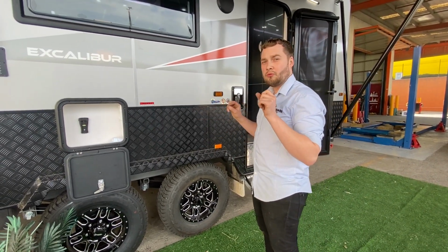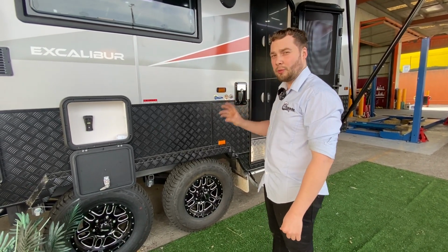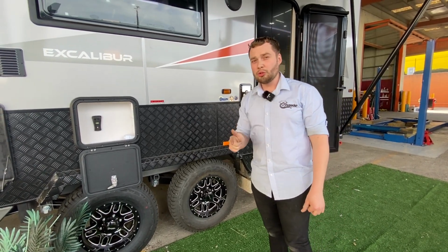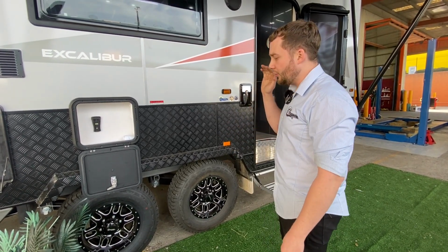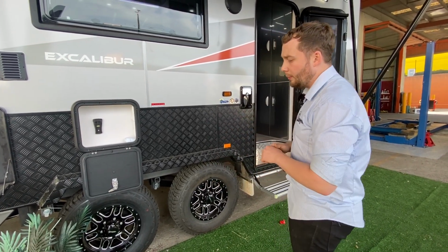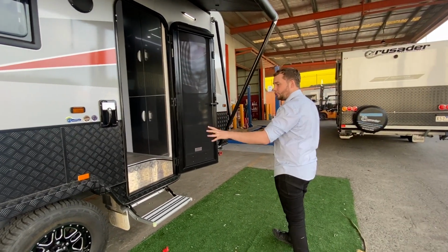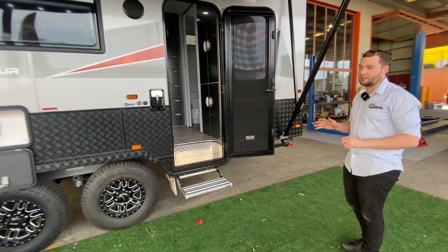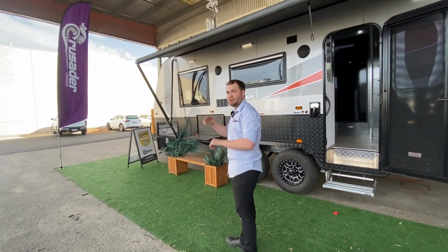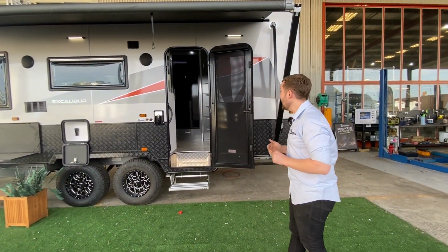Featuring a very, very high quality, Australian made, tough ride, 3.3 ton, 10-inch brake independent suspension. So that's a single shock coil spring suspension with the ability to adjust camber, and these are fully wheel aligned before you get them as well, just to make sure, again, trouble-free, but mounted onto a subframe like the Intel Engineering chassis with a 6-inch A-frame that runs all the way back to the wheels on top of that 6-inch chassis. You're not going to have any problems as far as flexibility, movement, or any headaches along the way.